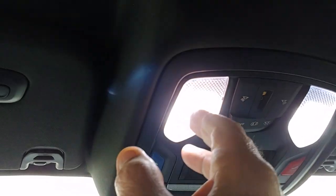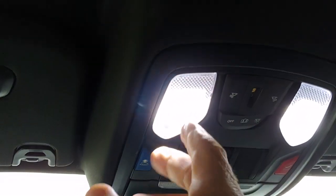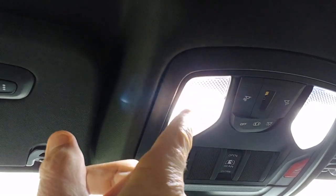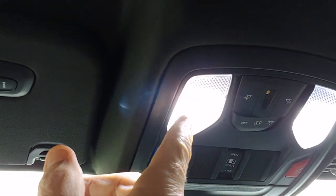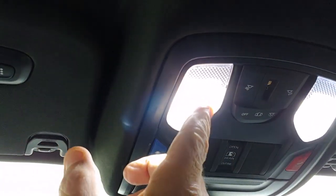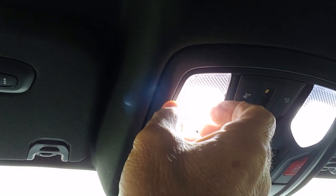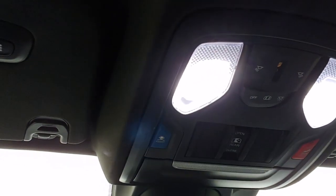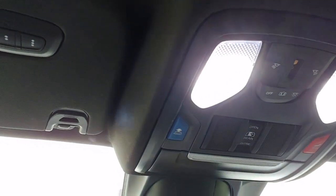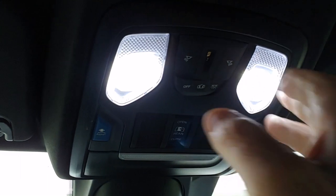If you're having problems getting the reflectors out over those things, all you have to do is insert a small tool up into there, push over on that articulating socket, and people were wondering why it looks so cheap. It's so it can move. Push over on it and this reflector will come right off. Once the reflector comes right off, you can simply reach up in there with your fingers and pull those out and just push in the new one. You can do this on both sides.